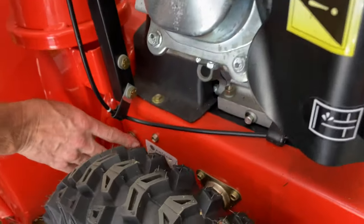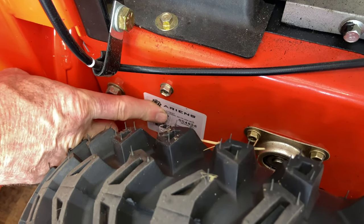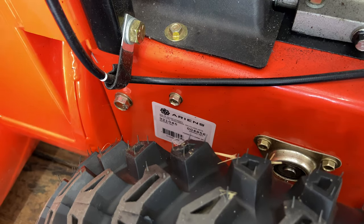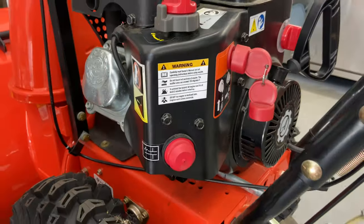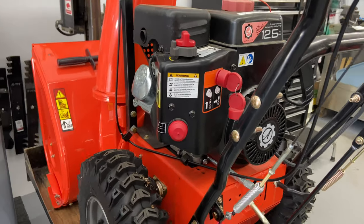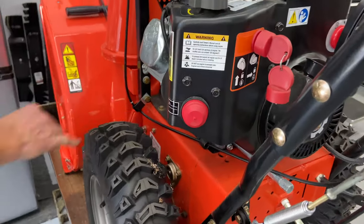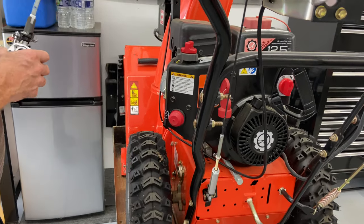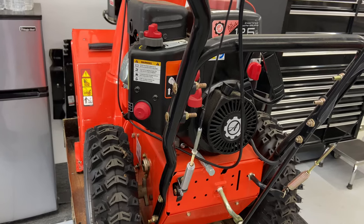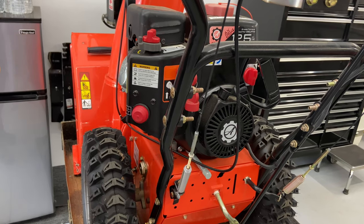What you have to do is come down to your tag, which shows the model number and the serial number. Go to the Ariens website for parts lookup, and for your machine — this is an Ariens Deluxe 24 — you take those model and serial numbers, put them in, and it's going to bring up your machine. They're all a little bit different. Maybe one carburetor will go on many machines, but you just have to make sure you get the right carburetor for your machine.